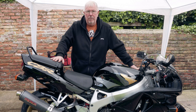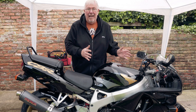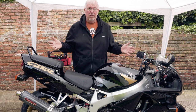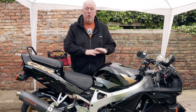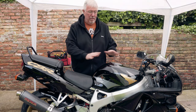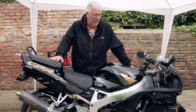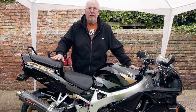It isn't a professional job. You can see where some of the clear coat is perhaps a little bit thin, and having painted outside, the first bit I did, I know not to paint in full sun. I didn't think the sun was coming out, and it did cause more orange peel. So that didn't really hurt, because I did a second coat on it. I did another wet sand and a coat on it, and it's actually improved it massively. Now, I'm very pleased with it. Have a look round, see what you think of it.